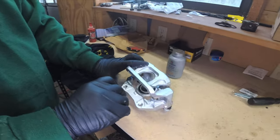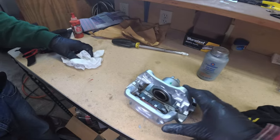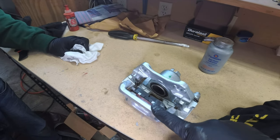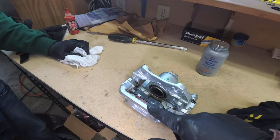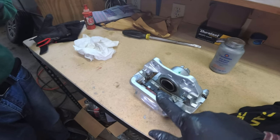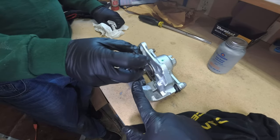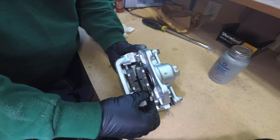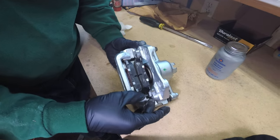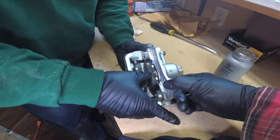Push the brake pad all the way into the top of the piston. One thing to note: we had to redo this — make sure you do the front side of the caliper pad first. We were not able to install the back pad first, so do the front pad first and then you should be able to assemble the other pad into the back of the caliper much more easily.